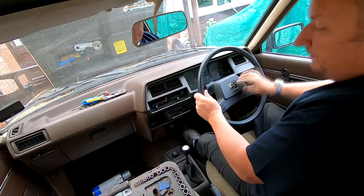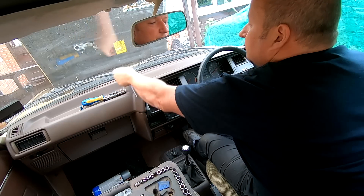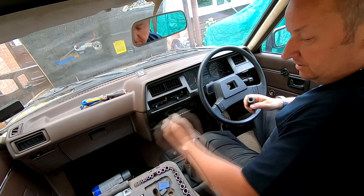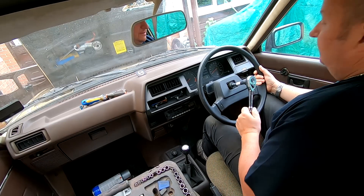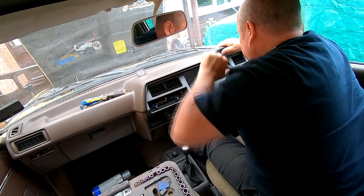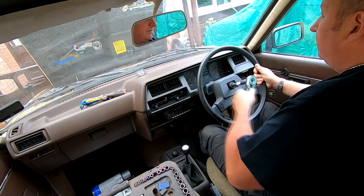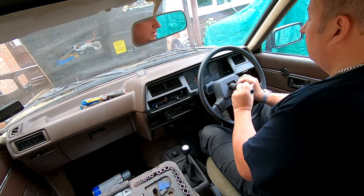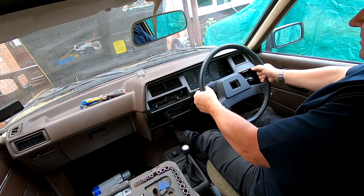I've had a look at the manual and apparently I've got to prise that centre bit out and get the steering wheel off. Get the wheel straight — that's common sense really. What size nut is that? It's a 19mm. Hopefully it won't be that tight. It is tight. Lucky enough on a car this age you don't have any airbags to worry about. The manual says you remove the steering wheel and then you gain access to the indicator stalk. That's the nut off — and good old-fashioned little wiggle and it comes straight off.